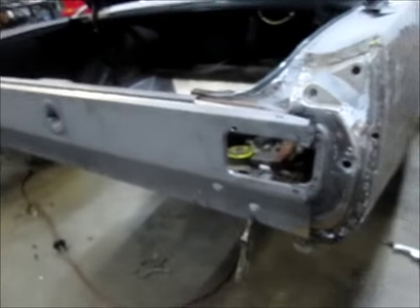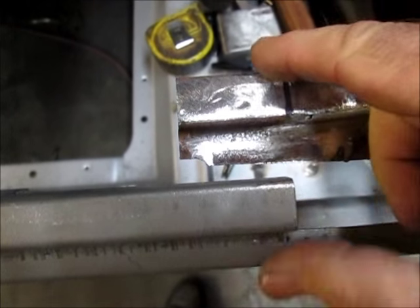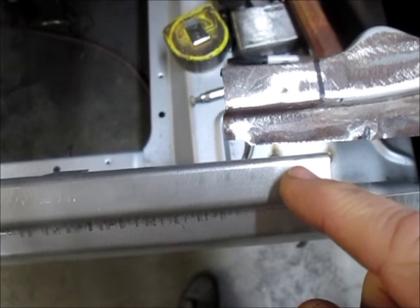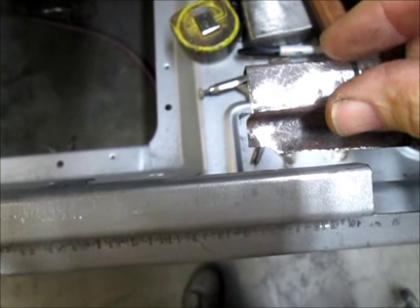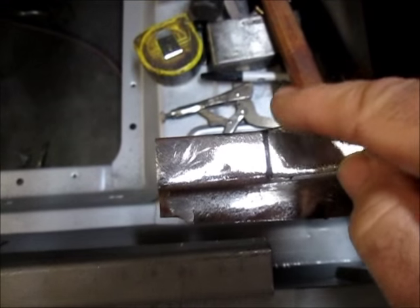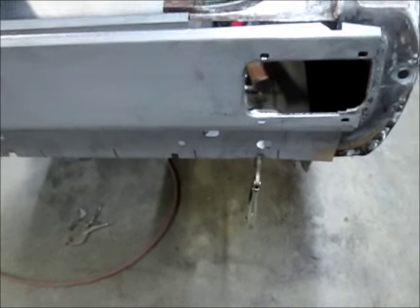Once I'm done with a little undercoating it'll blend right in. Now I'm working on the tail panel. I talked about earlier not liking the way this gap was wrong in comparison to this piece, and I talked about reshaping it. I think that would be a lot of work that may not be very beneficial. It'll be simpler if I take this piece and narrow it - cut a line right here, pinch it in, find the width I need to make it fit, and then weld it back together. It'll be a simple transition from this hump and will blend right in.